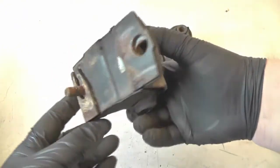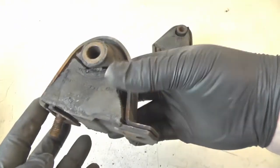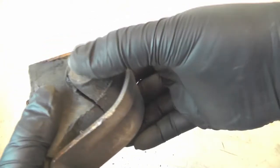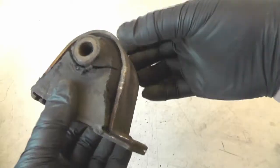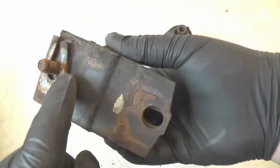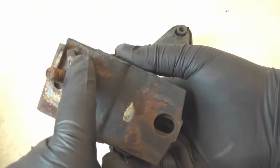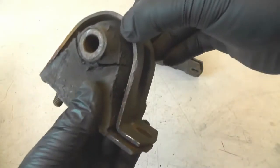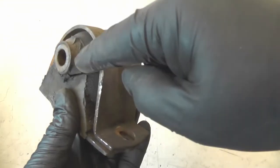This is a driver's side mount, which is installed in a similar fashion. While this one has not ripped apart completely, you can see there's quite a bit of cracking along the steel tube. This outer steel shell is really just sitting there, and the way they secure it is by simply bending over this tab. I'm going to bend this back straight and take this shell off so that we can see down on the top part of the mount.